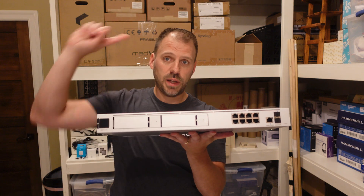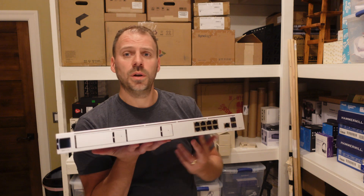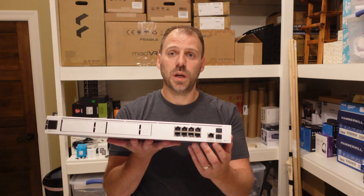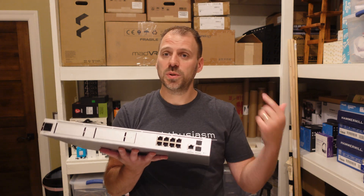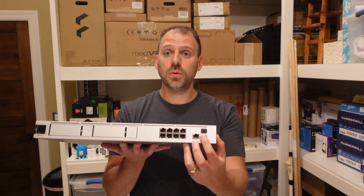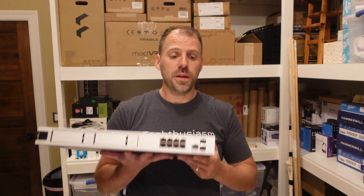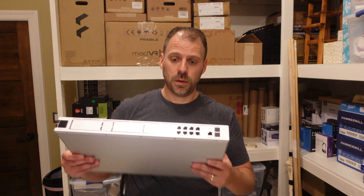We have two hard drive bays, and I have a couple of four-terabyte Western Digital Reds that I recently pulled out of another NAS I wasn't using — ready to go for this. We do have some built-in switching: eight ports, gigabit — not 2.5G, but gigabit LAN ports. We have a 2.5G RJ45 WAN port, which is what I'll use to connect to the cable modem for my 1.2G internet service. Then we have two 10G SFP+ ports — one for a local uplink, which will connect to the Enterprise 48 PoE, and if you've got super-fast fiber, there's also a 10G WAN port available.